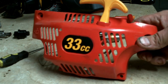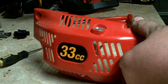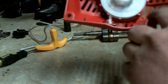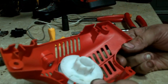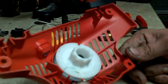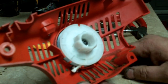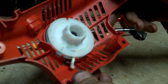Good afternoon, Moremedic One. How many of y'all have had this problem — pulling the rope out? The rope usually breaks at the rope rotor down inside where the rope ties the knot. It normally breaks about one inch out of there. The reason it breaks is they put in a four-foot rope, but most American-grown men have a six-foot arm span, so they pull it all the way to the end and it breaks or weakens the rope. I'm going to show you how to rewind this.